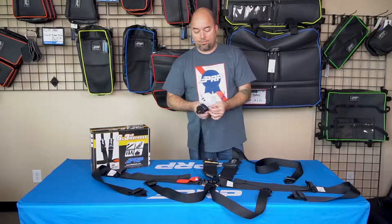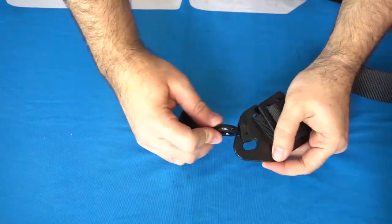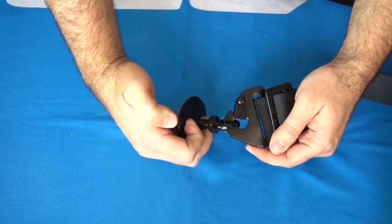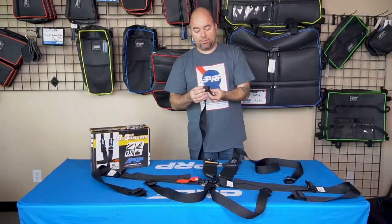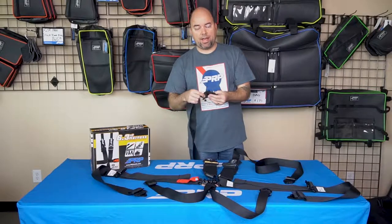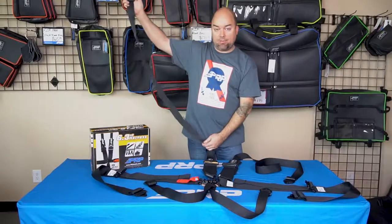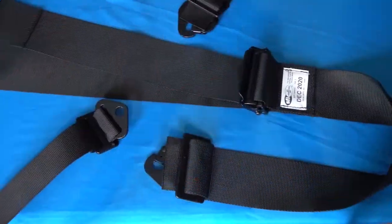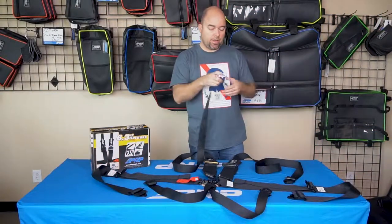The shoulder straps also have clip-in attachments, so you'll need an eye bolt kit, which we offer as well, and either weld on the eye bolt or bolt it in behind the shoulders. You can also wrap these around — the instructions are in the box on how to do that, but it just wraps around your roll bar. We made the shoulder straps and the lap belts extra long, so in case you have a roll bar that's a little bit of a distance behind the seat, you have that extra distance there.